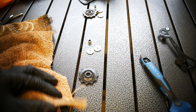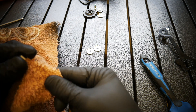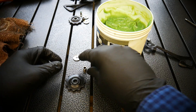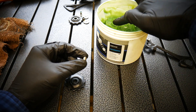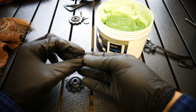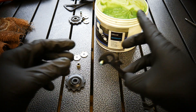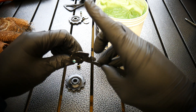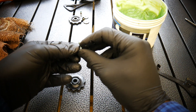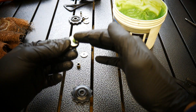This is a very good thing to do on the pulleys. Also the bushings - you want to have those bushings clean from the inside and from the outside, and now we are putting the grease. We want a lot of grease right here. The problem is you can put it on the bushing but when you push the bushing inside the pulley there's not much space between those two parts - the grease will be pushed away. So it's good to do it a couple of times and try to push the grease inside between the pulley and the bushing.